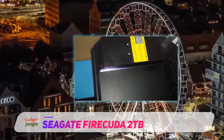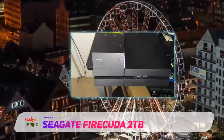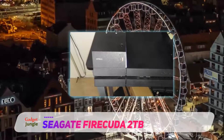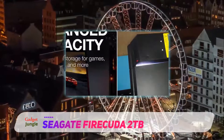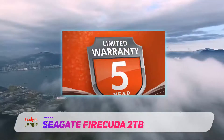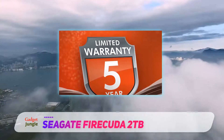It is only available in 1TB and 2TB versions, since any lesser capacity is not really ideal in this modern gaming era. The Firecuda 3.5-inch SSHD is the bigger desktop version of the Seagate Firecuda 2.5-inch SSHD, and comes with 7200 revolutions per minute, 64MB of cache, and a SATA 6Gbps connection.